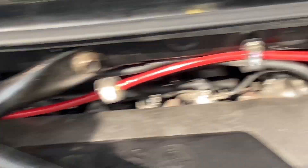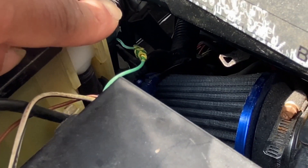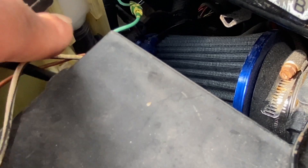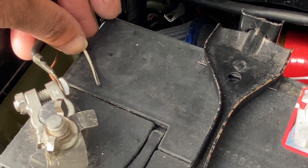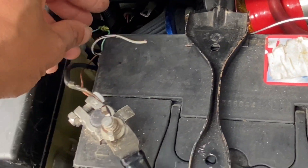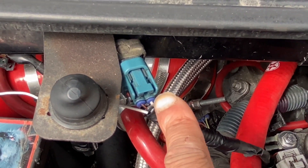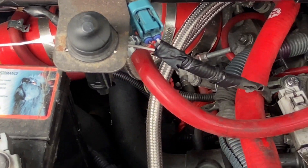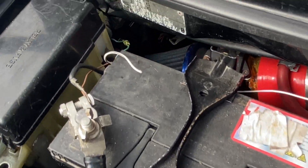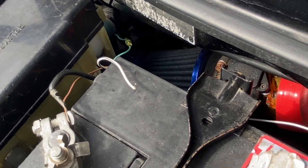For the AFR I needed a permanent live, which I basically ran the cable through there, and it goes in the back where there's a connector - I put my connector there too. Then there is ground - this one is actually for ignition live which I didn't connect. The ground is the brown wire, which I connected to the ground there too. Finding the ignition live was a bit harder, but what I found was this cable - the right one - is ignition live, so I decided to just tap it from there, and it works absolutely amazing.